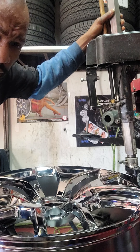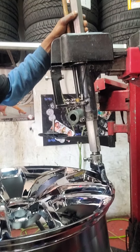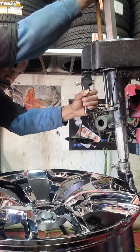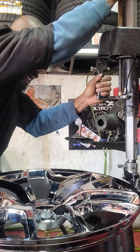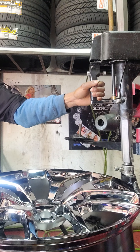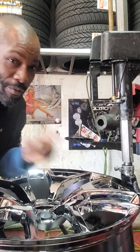Let's change out the head on the arm. Now as you can see, the arm doesn't necessarily sit perfectly — it's a little ajar. So you've got to adjust it just a little bit in order for it to fit. What we're going to do is lift it back up a little bit, hold it, drop it like it's hot, lock it in place, and let it come down. So it's sitting on the rim nice and firm. You never want to scratch the rim.